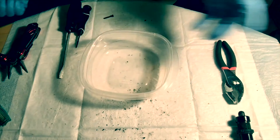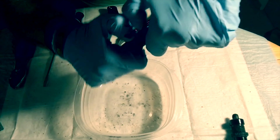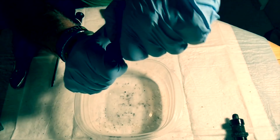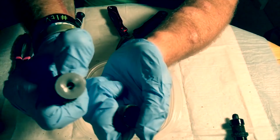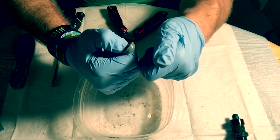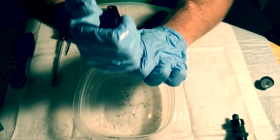Get your drain pan ready — Tupperware works best and is often easier to clean. Take your tools — I have my multi-tool here. Be careful when you're pulling this cap off because there's a bladder, like a ball, at the very top of the cap, and you don't want to lose that because it will pop out. Pop the cap out — it's relatively just a cap. You also have the bladder on top. Pop out the bladder and put it in your little container, or just put it in the cap. I like to put it to the side, preferably where there's no dirt at all. Now just dump out the old oil.